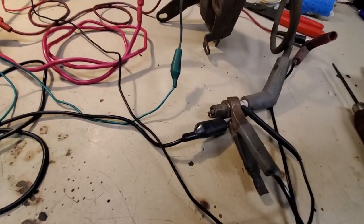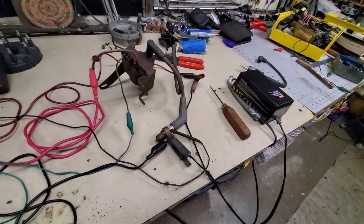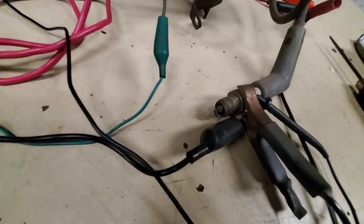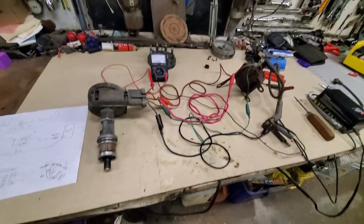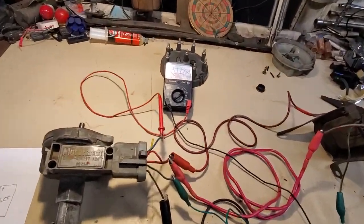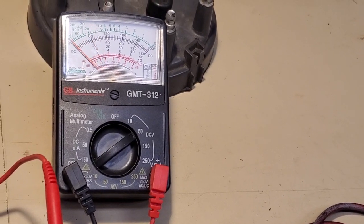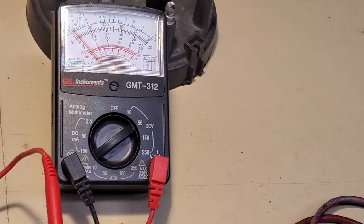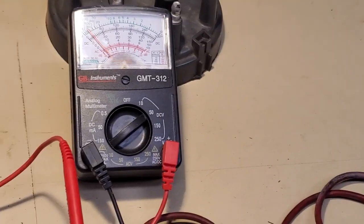See the spark — that's me turning this right here. We can also see on my multimeter over there. I'm going to zoom in — I'm looking for my five to seven volts, and on average that's what it's getting. You could hook your distributor up to a drill and run it too. That's telling me things are working, and my ignition module is getting warm.